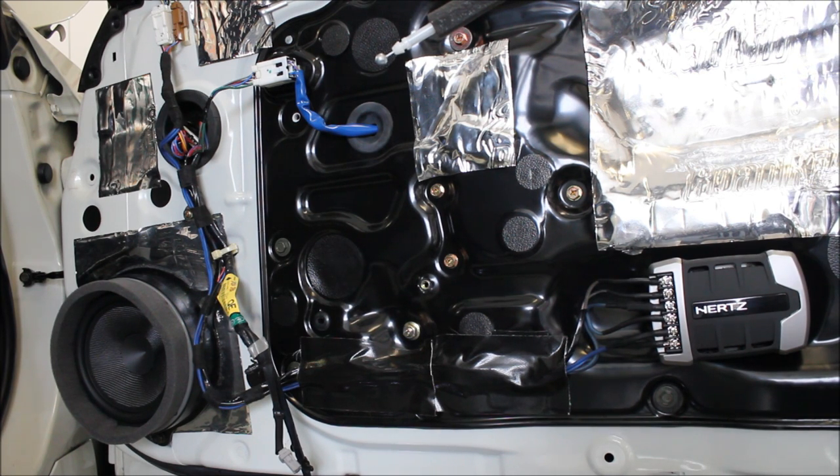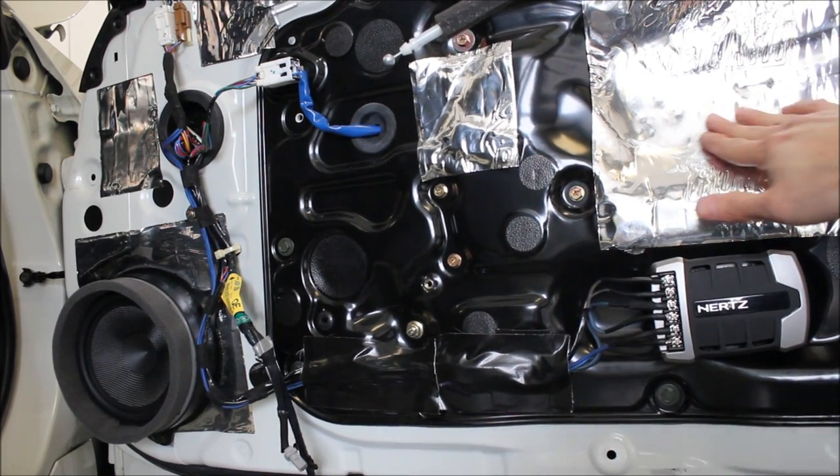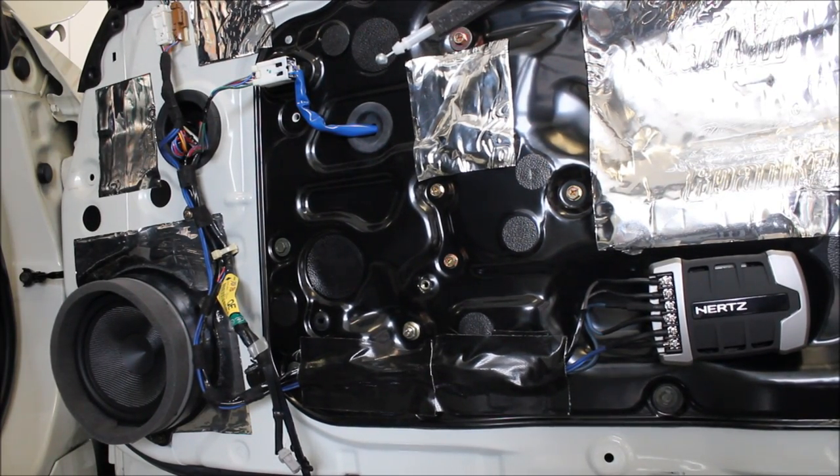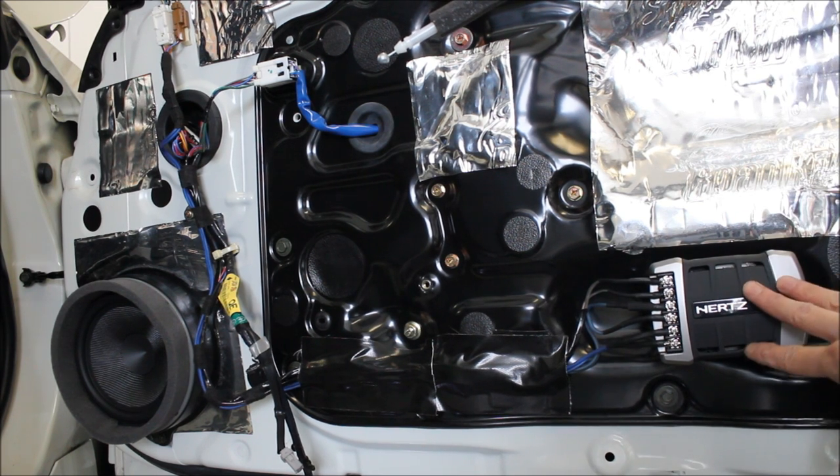I've pretty much finished the door and we're ready to put the door skin back on. I've only done critical areas that were necessary for actually deadening the sound, so it doesn't have that tinny sound anymore on the door. I know a lot of people are going to say there's too much weight in the door, and I get it — these doors are heavy and the bushings in them can go pretty easily. I've already had this car's bushings go on the driver's side and had to get the whole hinge replaced because it's one assembly. That's why we focused most of the weight towards the hinge, with barely any weight added towards the end of the door where it would cantilever the most. We're making this door as serviceable as possible while sounding good, and the crossover is mounted out of the way.